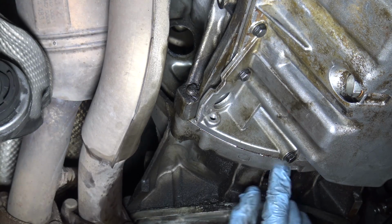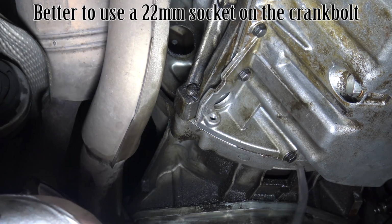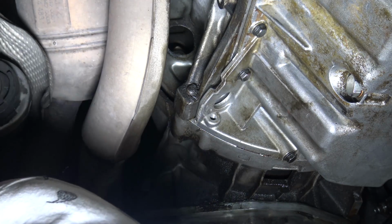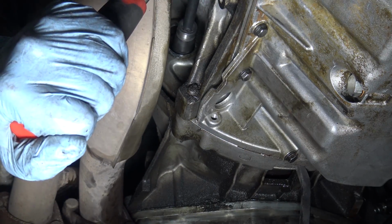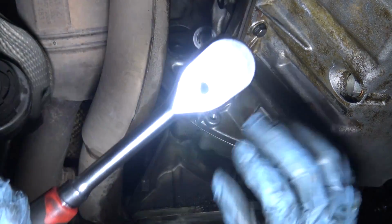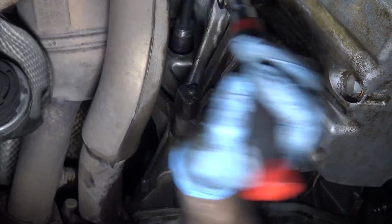The way you do that is you've got to rotate the flex plate, and you need a big screwdriver or a pry bar. And so, okay, I got 1 in view. Yeah, they're 17s. We've got to hold this so that it won't turn. There we go. She's loose. Never a phrase you want to say out loud unless you're working on a car.